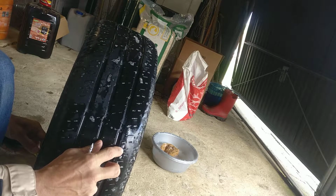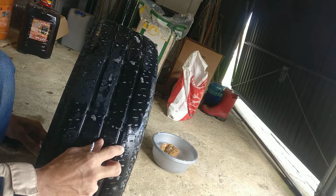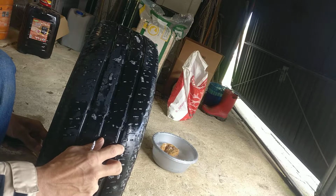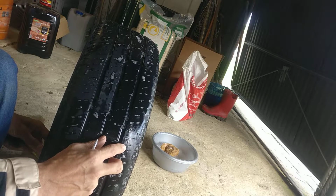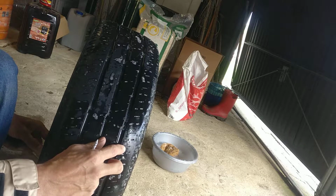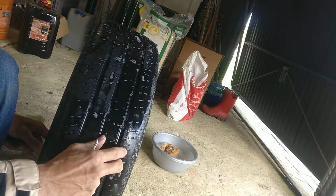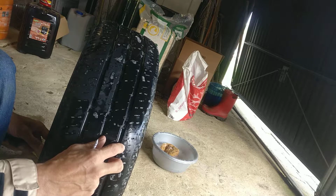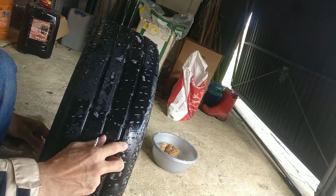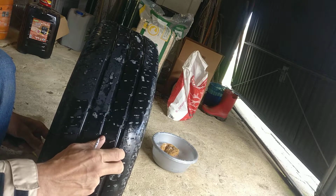This is from the van, so there's a lot of pressure in there, a lot of air in there. I think this one was 4.2 bars. Because of a van, a car normally needs like 2.5 up to 3.5 depending on the weight, and you better just check the manufacturing manual of the car on which you want to do some works, and to know what's the exact pressure you need to put in tires.